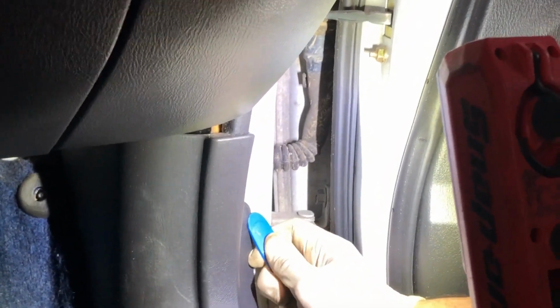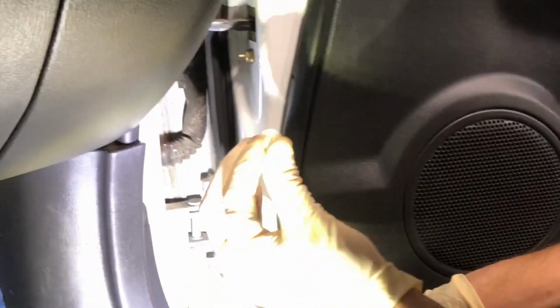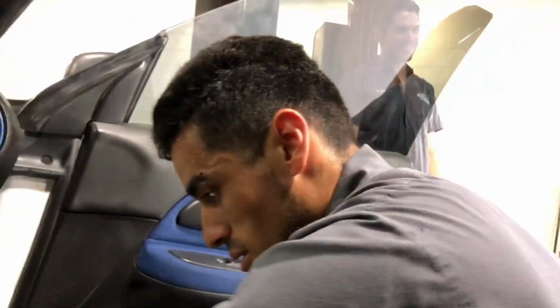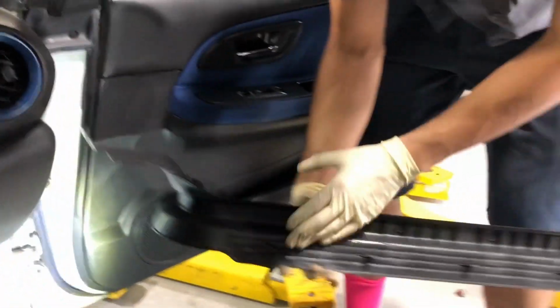One that preferably doesn't flex just by looking at it. Flatheads will work too. Mistakes might be made. Technical difficulties will be had. Black insert. Work that back. Make sure you don't lose the white inner. Then you can begin pulling up and out with the panel. Couple clips, pops right out.